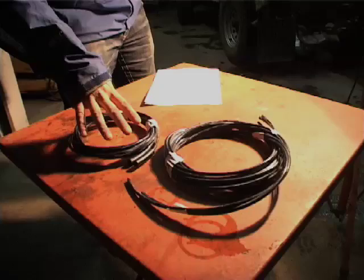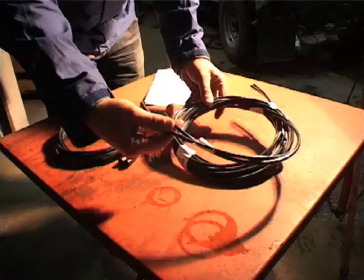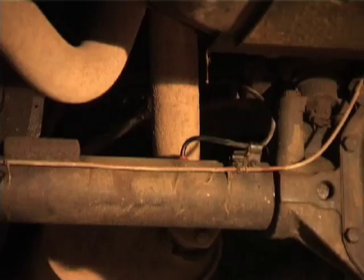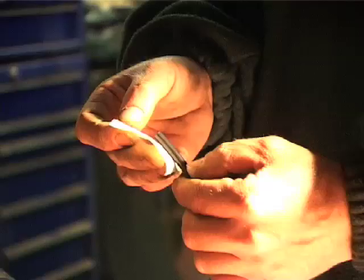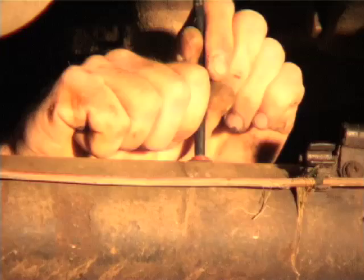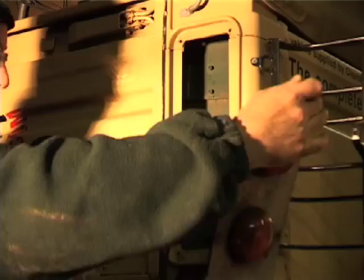Next we fit the Mantec breather kit. The shorter extensions are for the gearbox and transfer box, and the longer ones are for the front and rear axles. Locate your existing breather pipe, release it by pushing down on the washer and pulling out. Make sure the ends are cleanly cut and not blocked. When routing the breather pipes through the vehicle, cover the ends with tape to keep dirt out. Simply push the new breather pipe in and pull up to make sure it's secure. Follow the existing route of your old breather pipe. For a soft top, we've chosen to pass the rear breather pipe up into the hood stick; for a hard top, follow the wiring loom routing into the rear light cluster and up through the interior trim to the required height.